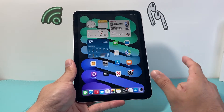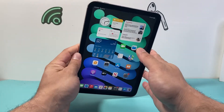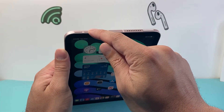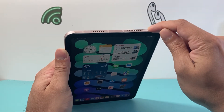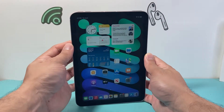But if all of these methods haven't worked for you, you want to try this method. If you have an off-screen iPad — this is a mini 6th generation — the volume up and volume down buttons are at the top. Press and release volume up, then press and release volume down, then hold the Touch ID or lock button until the screen goes completely black and the Apple logo appears. At that point, let go of the side button.